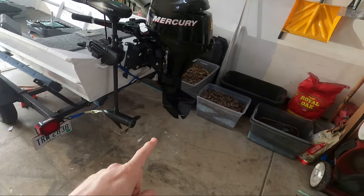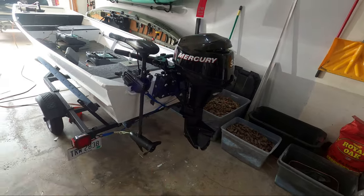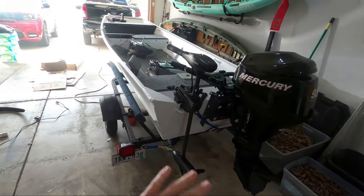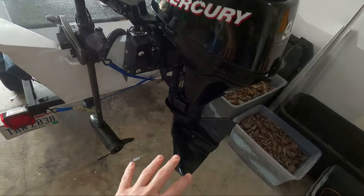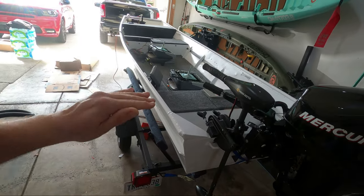When you're only going 15 to 16 to start with, it feels like a pretty big difference. This hydrofoil actually came on the motor when I purchased it, and I took it off originally because usually hydrofoils are used to fix a problem — they're not usually just a general performance upgrade that everyone should be doing. My thoughts are that if I can use this hydrofoil to lift the rear of the boat out of the water some, it's going to get us a better cruising speed.